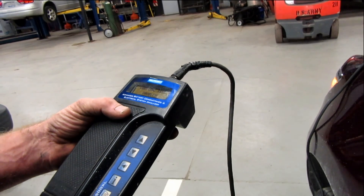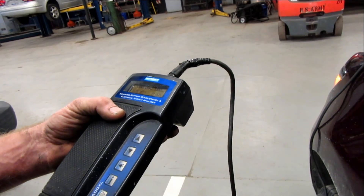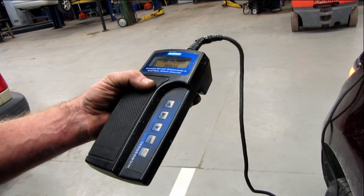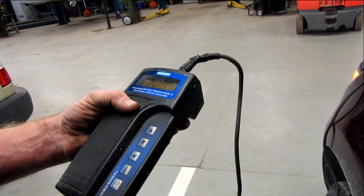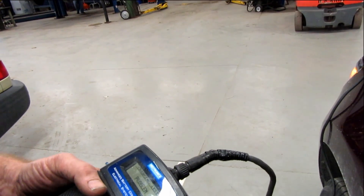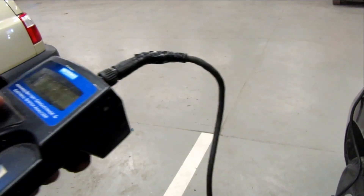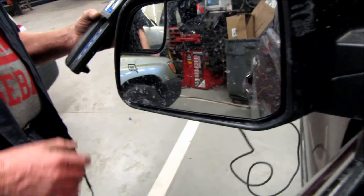It's shunting voltage — so it's not charging the battery when it's not charging. When you've got a load on there, it's drawing it down enough that it's charging, but it's not producing enough electricity to keep everything else going at the same time. This thing really did diagnose the issue. It gave me the right direction — I just wanted verification. Now I know I can trust this Solar a lot better. It's good to have a tool you know about — it's only 70 bucks and it really did tell me what I needed to know.